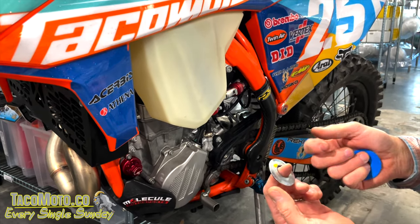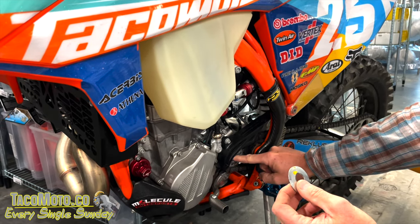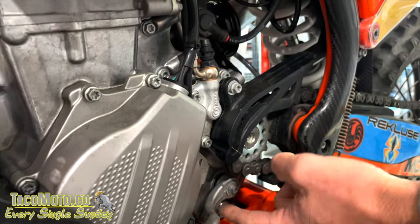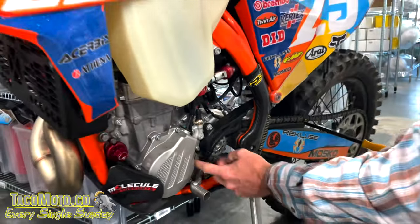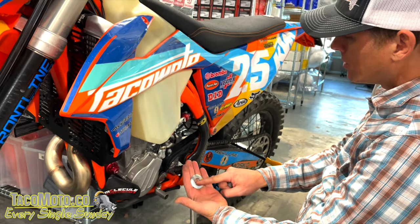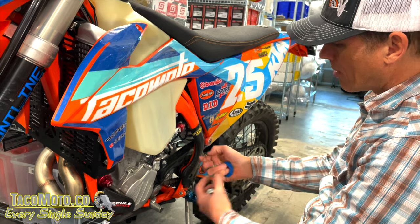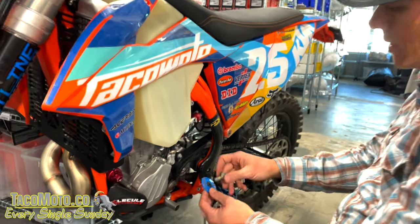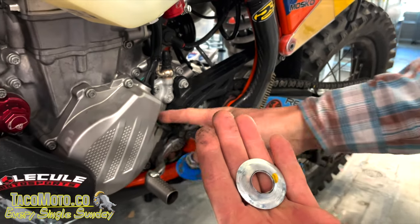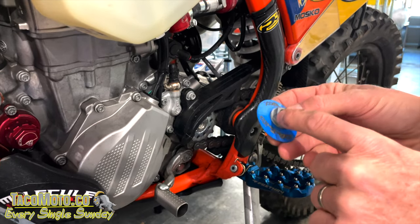This thing will eventually lose its tension. And underneath here, if you've ever replaced your oil seal or you've had oil leaking that collects on your chain and sprays — if it's all oily and dirty, you probably have a weak dome washer, and the O-ring behind there is no longer doing its sealing job. So on a new bike, we just almost automatically pull these things off — I don't want to be in Baja with oil leaking out of there — and pretty much by default put one of these on.